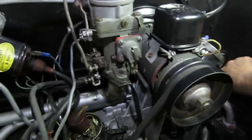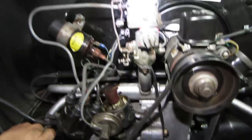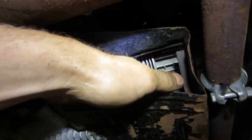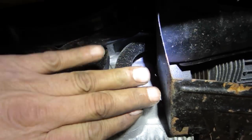So we're going to plug in the leak-down tester and see. That intake valve has an issue — yeah, that's one problem. I don't feel anything coming in between the cylinder and the head. I can feel the air blowing out of the crankcase breather, so it's coming out past the rings and the intake valve.